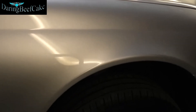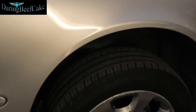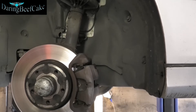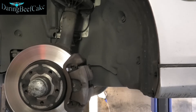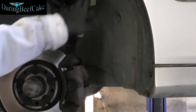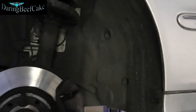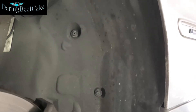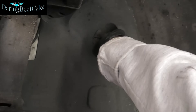I'm going to have a look at the siren first and try to disconnect it, and see if putting a fuse in there keeps blowing. Now the siren is sitting somewhere in the front. I'm going to remove the wheel and maybe remove the splash cover and then find that siren. So the siren in this W203 - this is the UK version, right-hand drive - the siren is on the left, on the passenger side, front wheel behind the mudguard here. I've noticed on some cars it's on the driver's side. We need to remove the mudguard - we've got these 10mm nuts, just a few of them we need to take out.